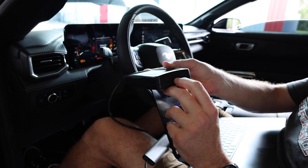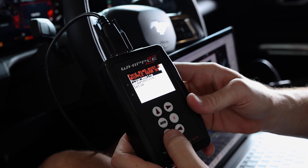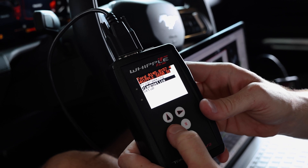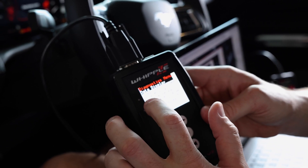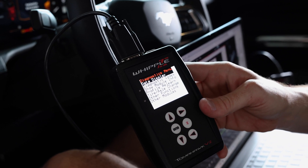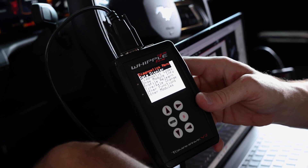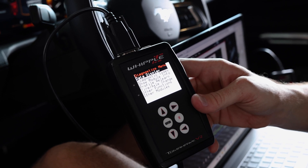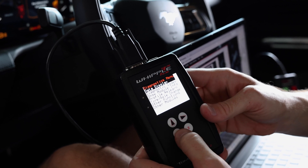Make sure you've got the SD card installed. The unit boots up and you've got this menu. You go to Diagnostics, then Data Display. You've also got things in there like Read Codes — codes tell you a lot. Sometimes it's good to reset the codes, drive the car, and see which ones actually come back. But this is about data logging, so let's go to Data Display.